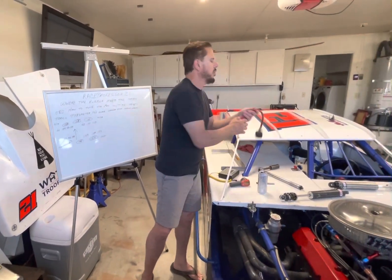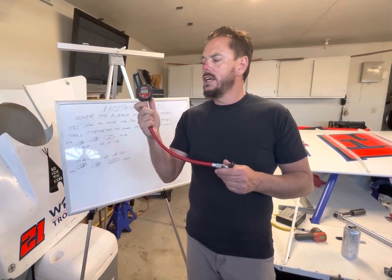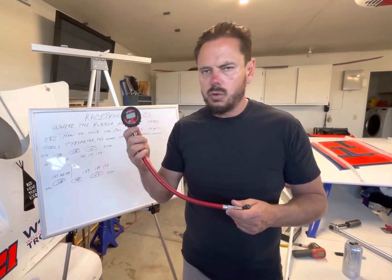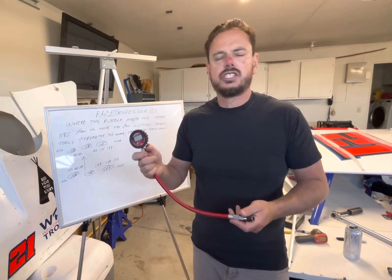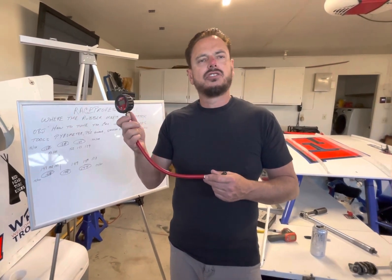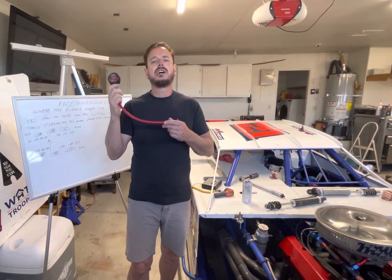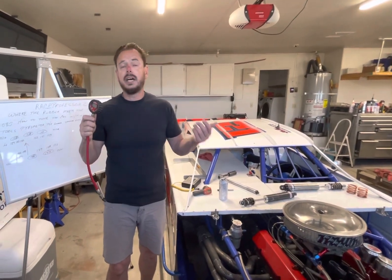The next tool you're going to need is a good pressure gauge. Do not go down to O'Reilly's or your local auto store. You need one that's very accurate, very calibrated, very reliable. This one's a Longacre — I paid around $100 for this one, and you can get them even cheaper. Don't buy a used one. I highly suggest buying two so you have a backup, because they're going to fail at the worst time. All these tools, especially electronic stuff, I have backups, because you get to the racetrack and it fails, you're screwed. You want to be able to get your measurements, use your time wisely — you've spent a lot of money to get to the track, so use your practice time, heat races, and main event to get the max amount of data to constantly improve your car.